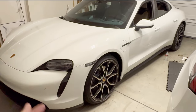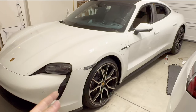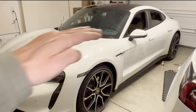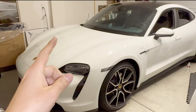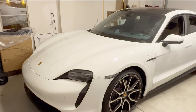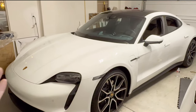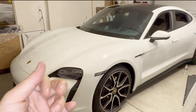In California the roads are very clean — no dirt or debris usually. But in other areas with back roads there's a lot of dirt, debris, and leaves that can clog those systems and puddle water in the rear seat floorboard. Right now mine is a little damp but when I unplug these there's no water coming out. I drove back and forth, applying the brakes hard to try to move the water to drain properly. About six months ago when I applied the brakes I swear I heard a water flushing sound from underneath the rear of my car — I didn't think much of it at the time.